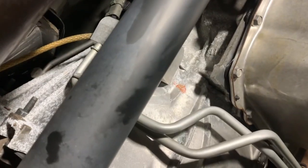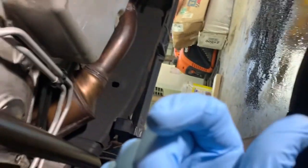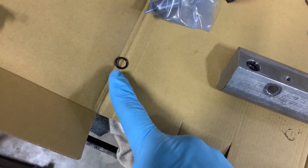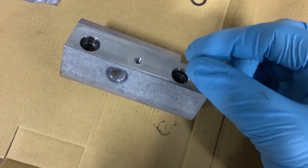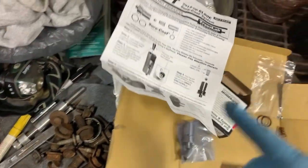As you can see, it's dripping just a little. When I pulled these lines out I found there are rubber O-rings in there — I'm guessing they seal on the line and seal up in there. When I pulled the top one out I thought I heard something hit the pan. I looked and saw one O-ring on the ground. The other one is still in there, so be careful when you pull these out — hold one hand here and use your other hand to slowly walk the line out so you don't lose those O-rings.